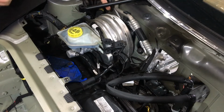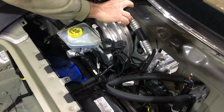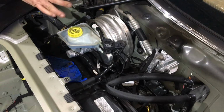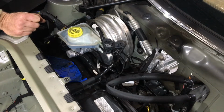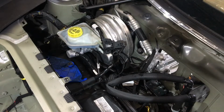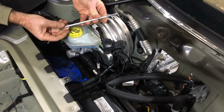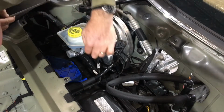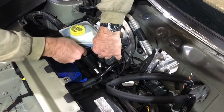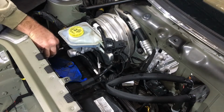which on this side here, because we've got the air conditioning lines, is a real pain to get out, and the wiper assembly here I've completely removed because this was all completely cluttered up. There was no way I was going to be able to get in there, so I removed the wiper assembly. I'll make another video of how to do that. It's pretty simple. But then those two bolts can be removed, and the ones that hold the brake booster look like this. There's one that is in there, going all the way like that, and then the other one is down the other side under here.